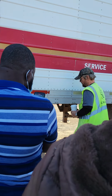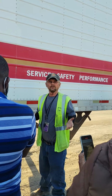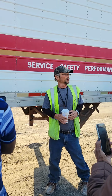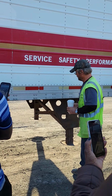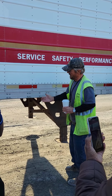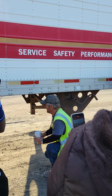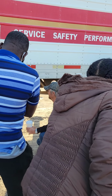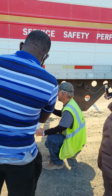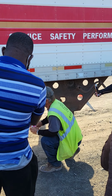Okay, back of my mud flap, and it's DOT required that you have your DOT reflector tape. Proper color, not ripped or torn, mounted and secured. Also, check for enough spacing or gap between the back of my tractor to the front of my landing gear. Now I'm going to talk about all my lights, reflectors, turn signals, four-way, brake light, running light, reverse light. All proper color and working. Not cracked, broken, mounted and secured.